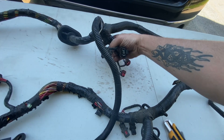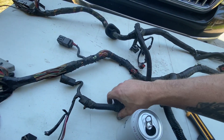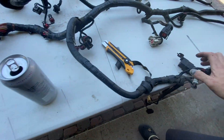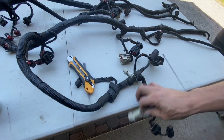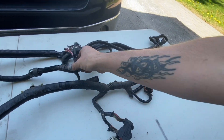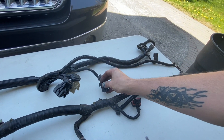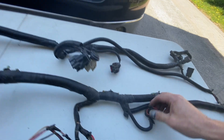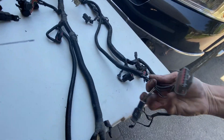When we get down here you get all your smog stuff, and this one also has the smog stuff. On this one, this part goes out to your AC relay and your O2 sensor. On the 91, you have your AC relay, your O2 sensor, your mass air, and then two other white connectors I can't remember right now. Then you've got your connectors for your salt and pepper shakers, which are the same on both. Then you have your connector for your map sensor - same. And then down here you have your distributor stuff, and then your other distributor stuff.